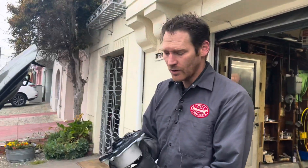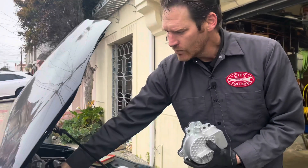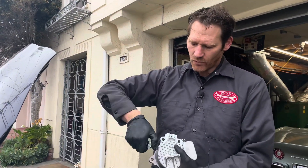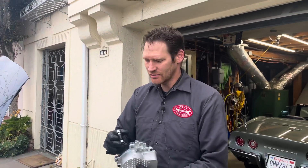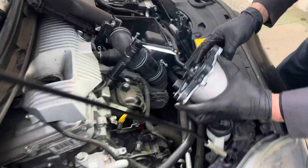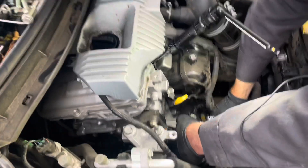Here's our new pump. In terms of figuring out your torque, you can certainly look up the torques and use a torque wrench. What I like to do is think about the handle length — with quite a bit of force on this little quarter-inch ratchet, I won't be able to get too tight on this, and that's how I'll control the torque. We just kind of work this guy back in there. It's only one way it can go.